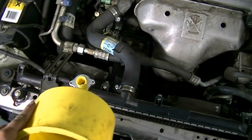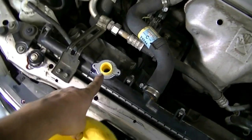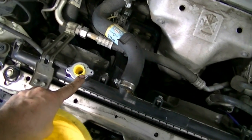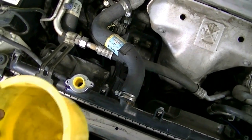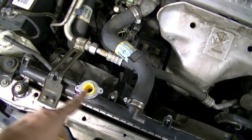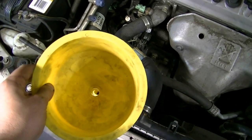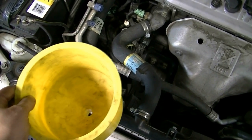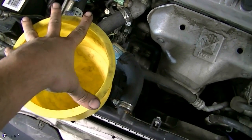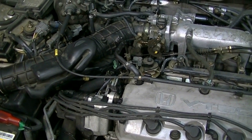Get a funnel and put it over where your radiator cap goes. You can use any funnel as long as it's the right size and airtight, but if you use one of those funnels from the auto parts store, make sure you pour coolant in slowly so it doesn't tip — since it won't be super tight, it could fall to one side, and once the car starts warming up the coolant will rise back into the funnel. This kit comes with adapters that hold it firmly in place and are also airtight.